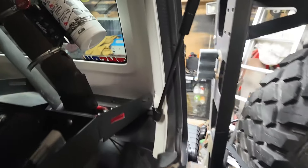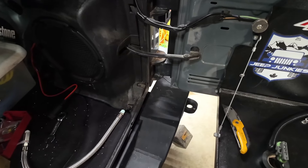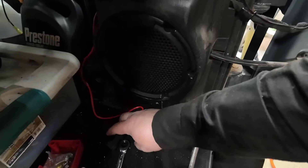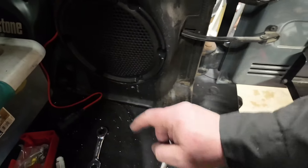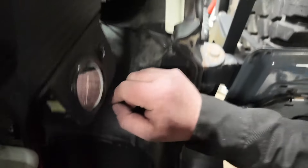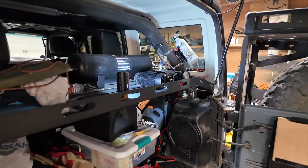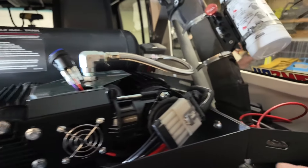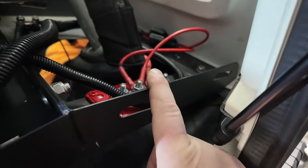I've also hooked up a 12-volt auxiliary socket. The Jeep JK has one in the back that a couple years ago I converted to full-time power for a cooler, but it just doesn't deliver enough power. This way, hooked up directly to a power source, I shouldn't have that voltage drop coming down the line. Coming inside the Jeep here — the hose is run, the power is run. I still got a cover down there so don't worry about the positive terminals being open. I'm hoping this is going to be a success and all my issues with slow airing up are over with.